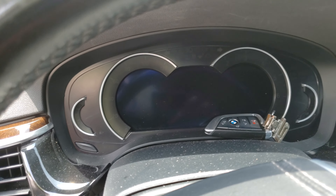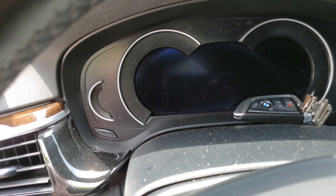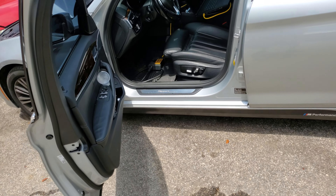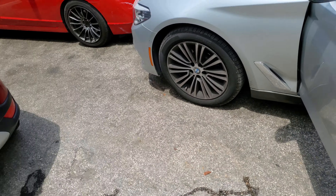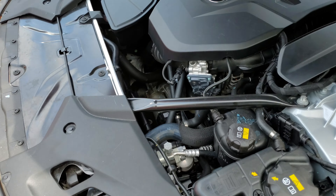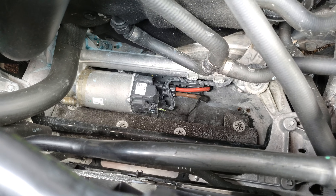It's going to write logistics and then we'll be able to finish. It's taking basically 36 minutes — it's called executing software action. The cluster is gone; it's going to turn terminal 15 back on. Terminal 15 is basically on but it's doing certain things — the CID turned off automatically by ISTA and the cluster light is also gone. We don't want to close the door yet because it'll get very hot, so we just keep the driver's door open and we wait.